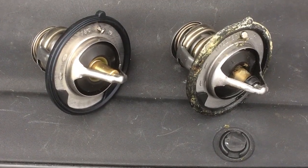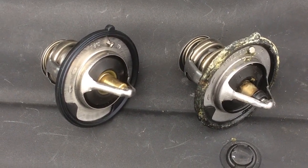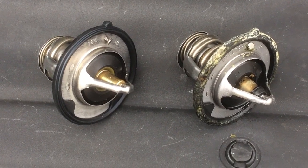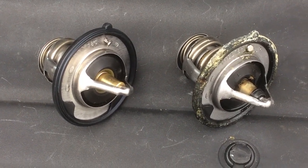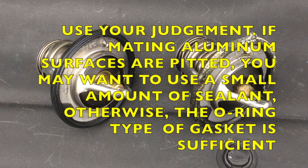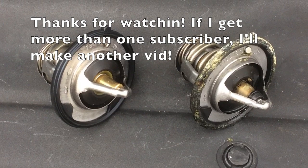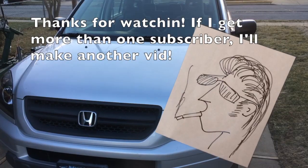Here's the old versus the new thermostat. Ordinarily Honda, with gaskets like this on machined surfaces, does not recommend putting any sealant between the thermostat housing and the mating surfaces — O-ring gaskets usually don't need sealant. However, after 20 years some aluminum machined surfaces get a little pitted, so I'll leave that to your discretion. Stay tuned — I fix all kinds of stuff: cars, boats, motorcycles, toys.